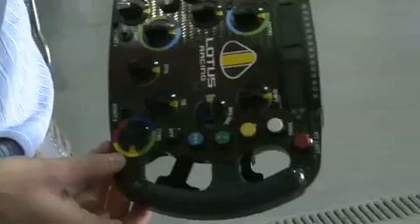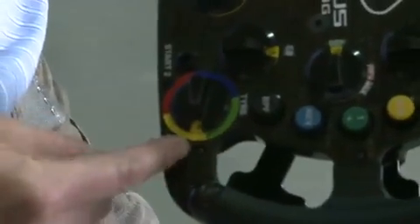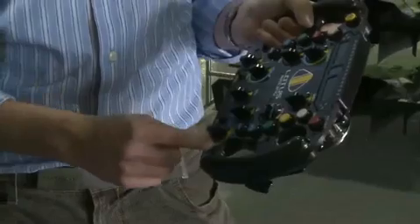We've got a tyre rotary here. The three different tyres that we use — slicks, intermediates, and wets — are colour-coded, and the final segment is just simply to turn the rear light on. The positions within each segment are for throttle maps. When you change tyres, the rolling radius of the tyre changes between slicks and wets, so we need to compensate for the wheel speed, otherwise the calculations go out for things like control of the differential and everything.